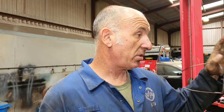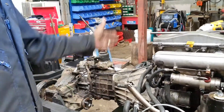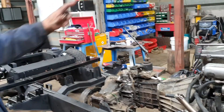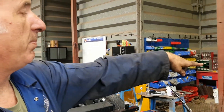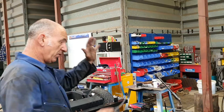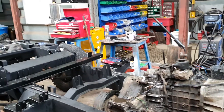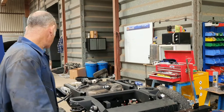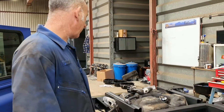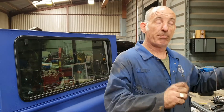Just getting the rest of the front end done so we can get the engine and gearbox back in — that's done now. Just tightening up the shocks and springs on the front end, making sure they're all connected. Then we'll go for a bulkhead fit straight after, because we've got a new seal frame, B-post and C-post to put together. We need to measure up, make sure that's correct, and then weld it in. Once that's in, we'll get the rear wiring loom put through. The chassis hole for the rear loom isn't quite big enough so we'll open that up a bit, then hopefully go for rear tub fitment — not bolted on, but tub on.